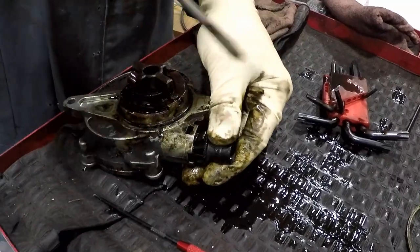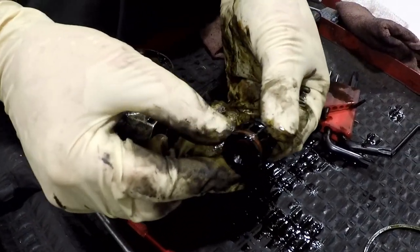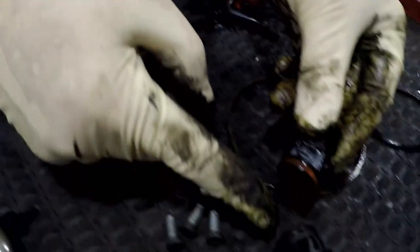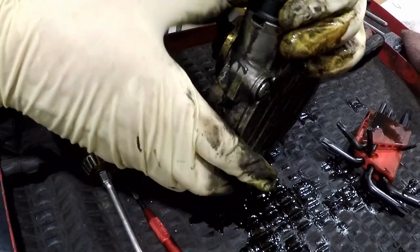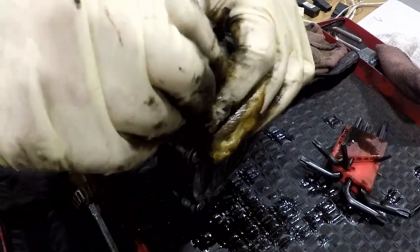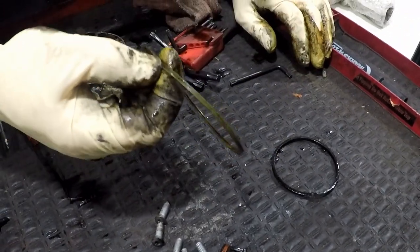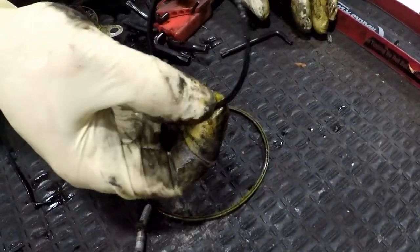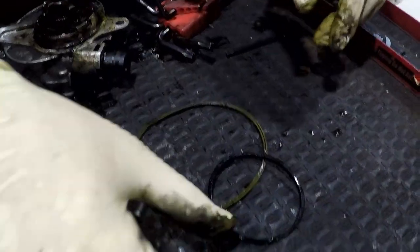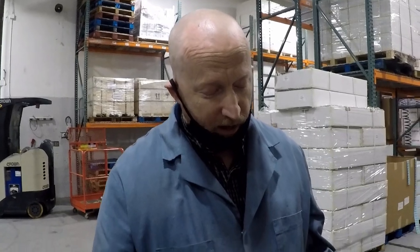You just tap and pry and this comes out. You'll also see that the seal on the valve is just done — we were getting a huge amount of leakage there. The new valve comes with a new seal which fits much tighter. Looking at the parts we replaced: the main seal between the two halves of the body was actually still pretty good — a green Viton seal with good long lifespan. But the seal behind the pump is just garbage; you can tear it in half now it's so brittle. And the seal on the valve was completely flattened out and wasn't sealing at all.